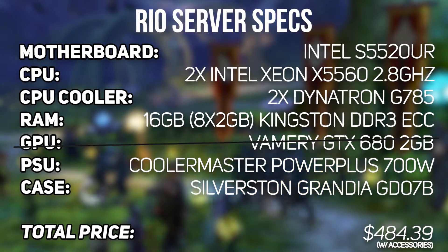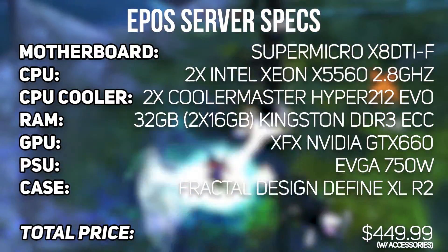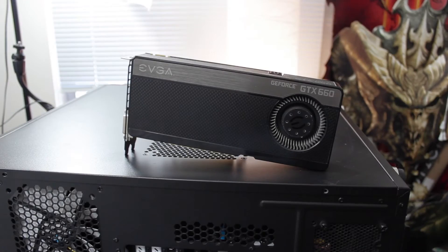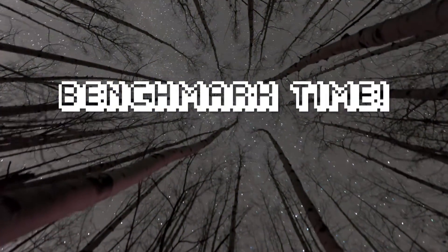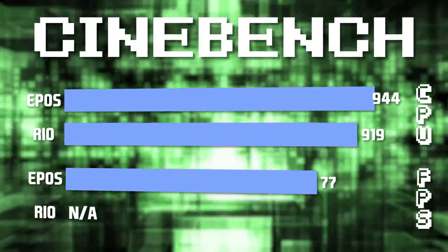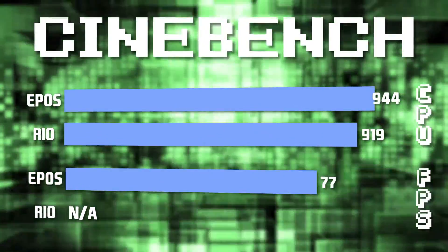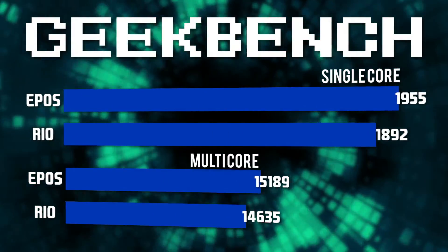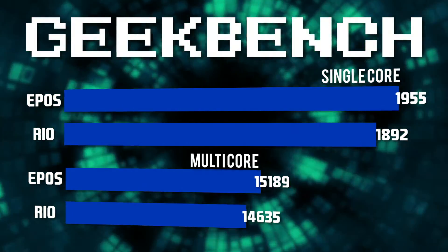For the purposes of my server, we spent about the same amount of money, and our performance comparisons are fairly similar. I'm performing slightly better in tasks that use a GPU because Ryo's server ended up not using a GPU due to his lack of a proper PCI Express slot. Whereas I was able to slap my old GTX 660 graphics card in there, so my build performs a little bit better whenever GPU acceleration comes into play — graphics rendering, OpenGL, Cinebench with graphics, and certain Adobe Media Encoder renders. Otherwise, we perform almost exactly the same. We have very similar parts, very similar specs — he just has a different motherboard, different case, and overall different intentions with his build moving forward.